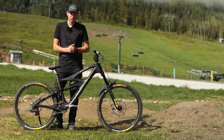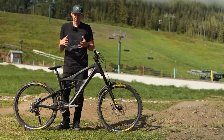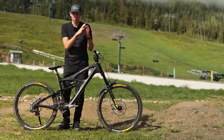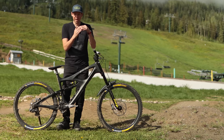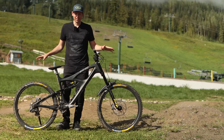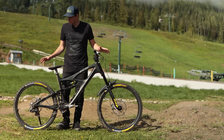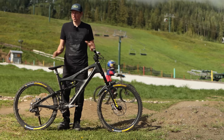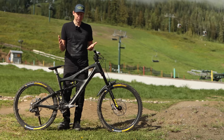And so, when you hit rocks, smashing into your rims, normally you're like, oh, I hope that giant piece of foam in my wheel is doing its job in protecting the rim. But this rim deforms and moves out of the way on its own. So I don't run inserts in either of my wheels. I hate running inserts. I think it's kind of silly if you ask me. And so no inserts, just my DH tires and the Zip wheels, and it's perfect. Able to run lower pressures, higher pressures. It doesn't matter with this wheel and tire combo.